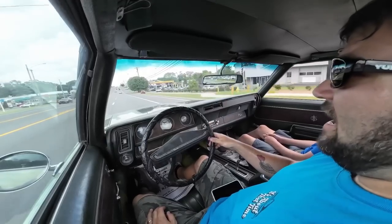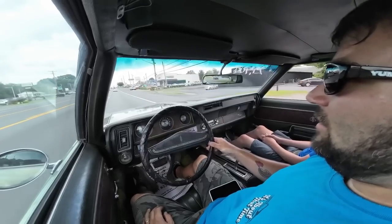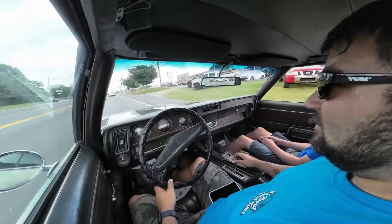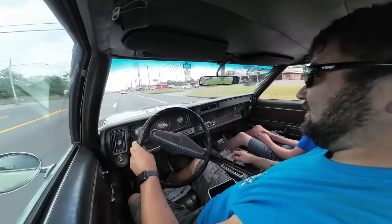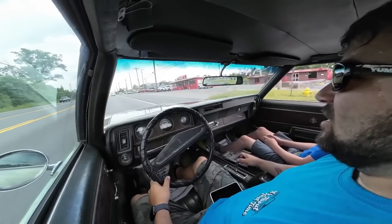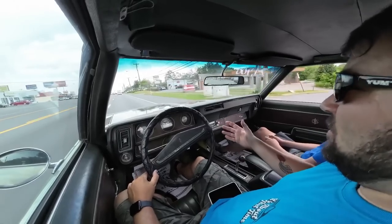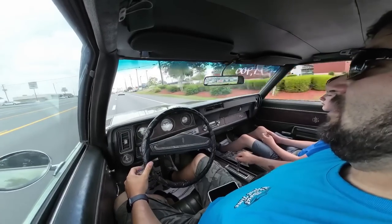Speedometer is working on the dash. You've got some slack in your steering. It's turning there and it's turning there. In the brakes, left pull. You feel it? Gave a little whoosh there. Let's try it again. See that left pull? Nobody's behind us, guys. Left pull. So the brakes are grabbing. What happens when I floor it? That's what happens when I floor. It's not kicking down. Passing gear's not hooked up. If I shift down.